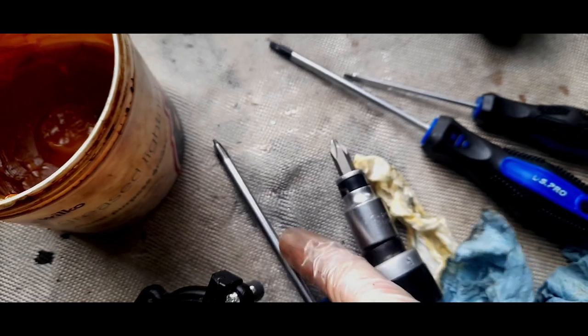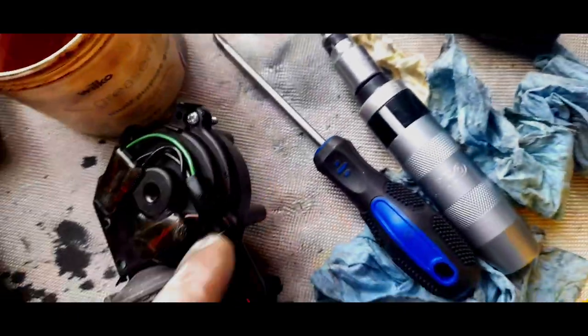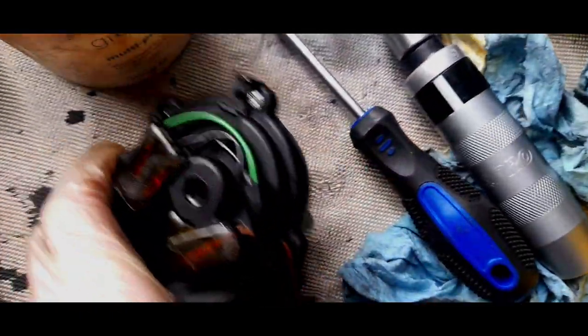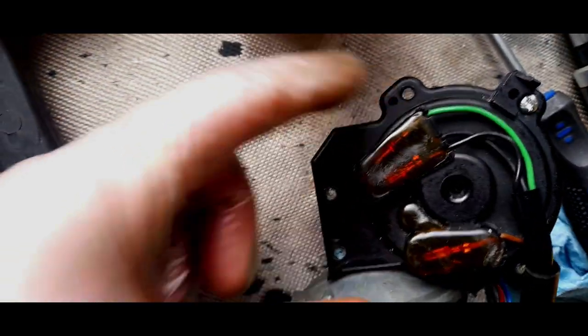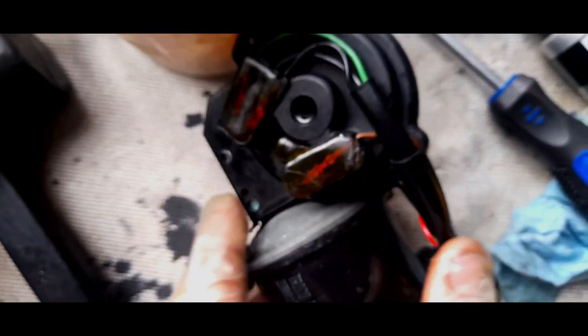If you've got one of these or a decent screwdriver, you can get it through that plastic into the metal, because you've already cut the metal. You don't need to tap it. These are self-tapping screws. They do what they say on the tin. So just go around, do that one, that one, that one, that one. Just be aware of how much the screws are actually sticking through. But in this case, it really doesn't matter. It works.